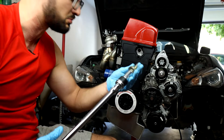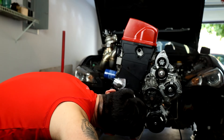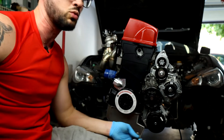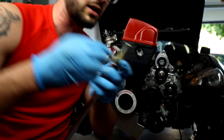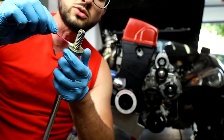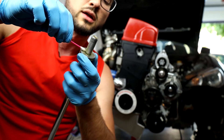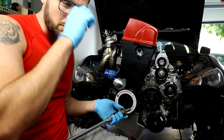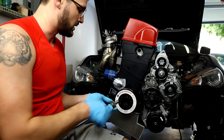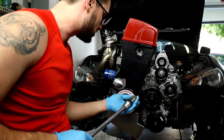Now that I've gotten a few cranks, I'm going to pull this back out and make sure everything still lines up - that we still have good contact between our key and our keyway on the new pulley. I'm going to apply a little bit of oil to the front of this washer on the stock crank bolt as well. It's going well - I'm probably about a turn and a half in, and I can see that the super damper is slowly getting pulled further and further in, which is exactly what we want.